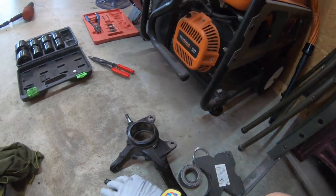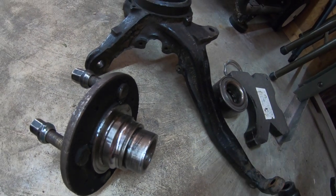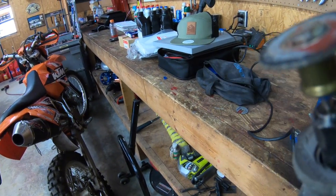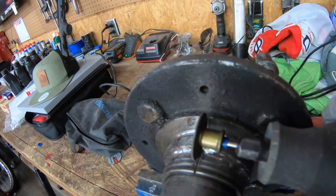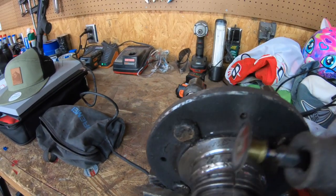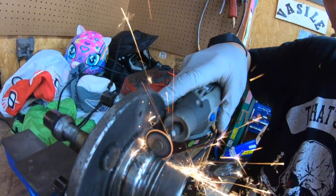Now what we've got to do: sometimes you might be able to hit it with the chisel right here and it'll snap — shattered. But most cases you have to cut it right there with the chisel and the grinder. I'll show you in a second. So you've got a grinder with a small wheel. You can tell the difference between the big wheel and the small wheel. The reason I'm using the small wheel is because you're trying to get as close to the edge right there. If you're using the big wheel, guess what? The big wheel is going to set you back a little bit, and you're going to cut into that — and you don't want to cut into that. So the smaller wheel actually works really good on there. See what I'm talking about? That way it doesn't hit the top.